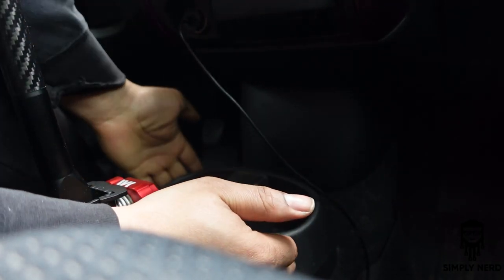Now in the front, there are two retaining clips. They pull straight up. So I recently installed some new ones. So it's gonna be very tight, but should lift straight up. So let's see here. I put my hand here on this side of the cup holder. Put the other hand on the other side. That's where the clips are. Just get it and pop straight up.